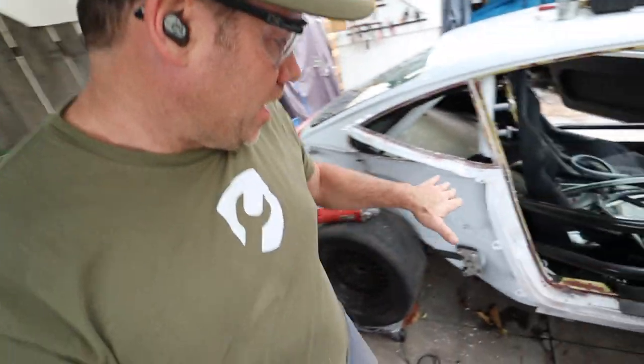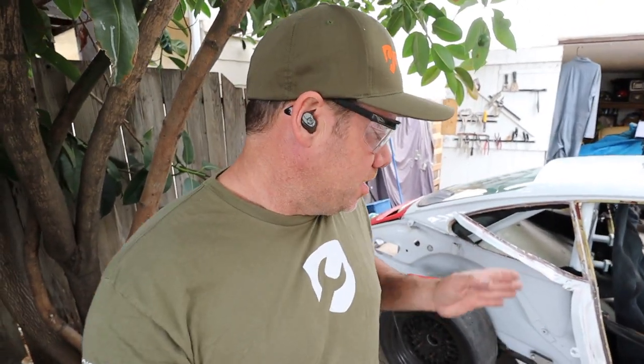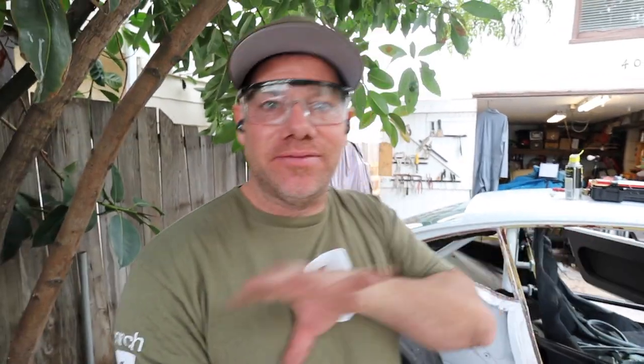One thing is a quick tip while I'm doing this. I'm pushing pretty hard, not going super fast with the drill bit. It's one reason I'm using a cordless, because it doesn't go quite that fast, but as I'm pushing, I'm feeling just a little bit of give, just a teeny bit of give, and as soon as it gives, I back off, because I don't want to go through. I just want to go through one layer, but not both.